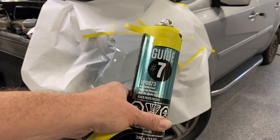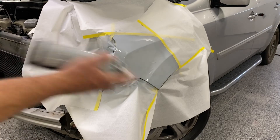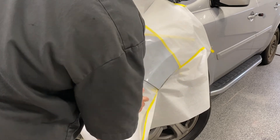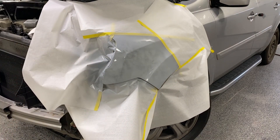So I'll probably spray a coat of guide coat on there and call that good enough. Okay, I'm going to spray a guide coat on there. This is actually the real deal guide coat. When we're sanding this, it will show me any imperfections as we block it. So I guess this is probably going to be the third video, and this will be the shortest. We'll see.